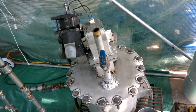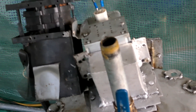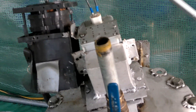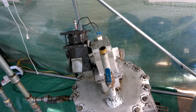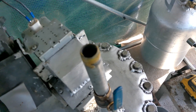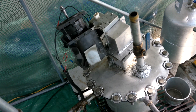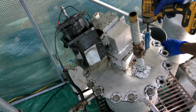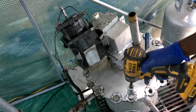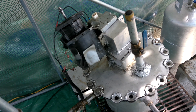After about five minutes, we have no vapor formation. This is kind of an issue, because with microwaves they heat up things extra quickly - normally we see vapor formation in literally the first 20 seconds. About 12 minutes in, still no vapor formation. The magnetron was starting to smoke because the microwaves were being reflected back to it, since nothing was really absorbing them well. So I decided it was a waste of time and energy, turned this thing off completely, and we're going to retry this with some catalysts.